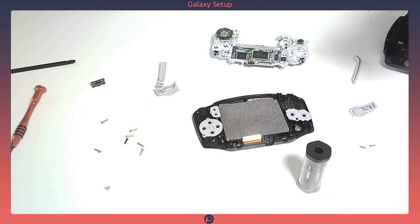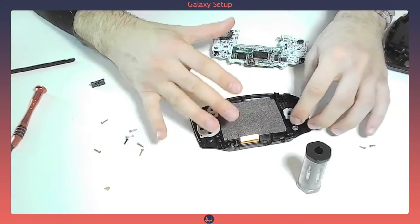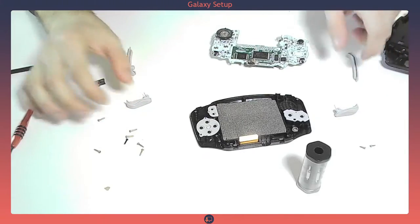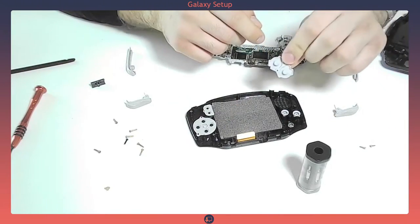This is the charger port, the shoulder buttons right here, and the back — we've already talked about it. If you need to clean some parts, or if a button doesn't work, you're gonna need to clean these contact pads because you could have some dust that blocks the contacts from the rubber parts to the metal contacts — that's what you need to do.